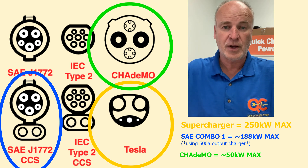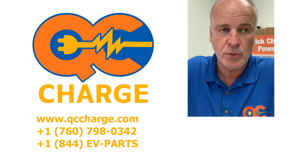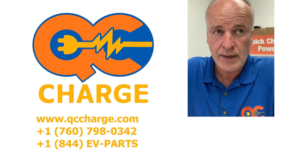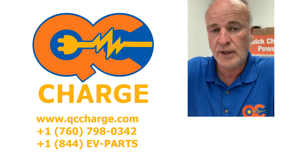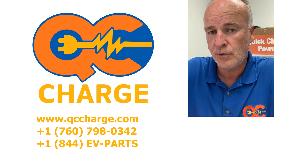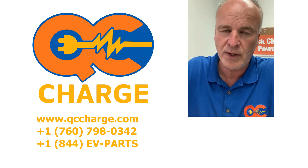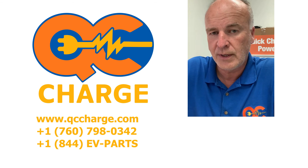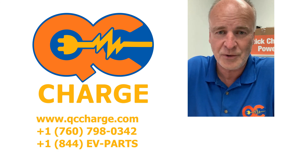I hope that all helps. We're going to have, as we always have, the CHAdeMO adapter here at QC Charge, and we will begin to market the CCS adapter for North America — again, restricted to cars that can physically use it. That'll be the 2020 and newer cars. I expect Tesla will have some kind of retrofit of a charge port with the correct communication protocol, and then update the software so maybe older cars can use it too. But no matter what, if you buy one, be sure and test it right away and make sure it does in fact work — don't throw it in the back of your car and assume it'll work someday. I'm Tony Williams for QC Charge, thanks for watching.